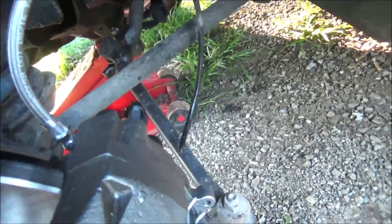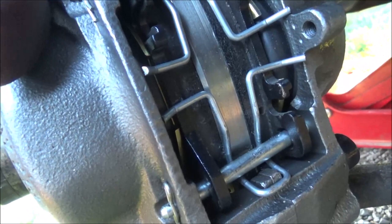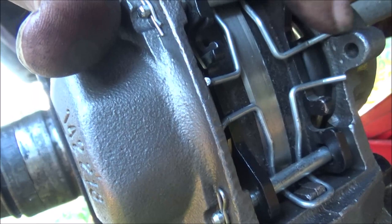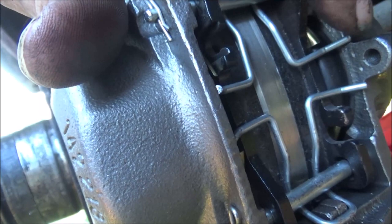And the two bolts in here, got the separator springs in to hold the pads back for release so they don't rub on the rotors. Fancy stuff. In America, they don't usually do this. They just let them rub. This helps keep them from squeaking, though. The brakes are pretty quiet on these cars. You rarely ever hear them squeak.